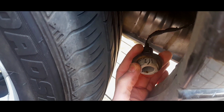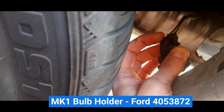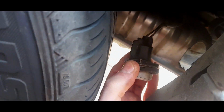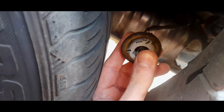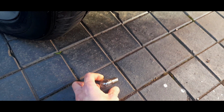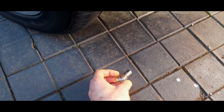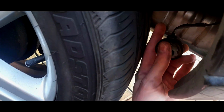What I will do is I will put these holders in the description. It may be the connection. Sometimes I think it pays to push this tab and take this connection off the actual light fitting, but usually it's not the connection between these two, it's the connection in here which stops that bulb from working, and it can cause these bulbs to blow. So it may just be preferential to actually replace the bulb even if it hasn't blown, because, I'm not being funny, filament bulbs can actually become less efficient over time anyway, as a matter of course, as the filament burns itself, because that's essentially how it works.